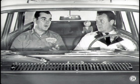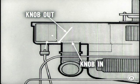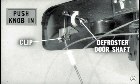Okay, I got that. Now, is there anything unusual about the defroster control? No, it's also a simple cable control door like the other two controls. When the defroster knob on the right side of the heater control panel is pulled full out, it delivers maximum defrosting. When it's all the way in, a slight amount of air still flows up the defroster ducts to the windshield. By using intermediate knob settings, the driver can choose just the amount of defrosting he wants. To adjust the defroster cable, disconnect the cable mounting clip and push the defroster knob in. Then turn the defroster door shaft clockwise as far as it will go and hold it there while you connect the clip. It's not necessary to remove the glove box to make this adjustment.